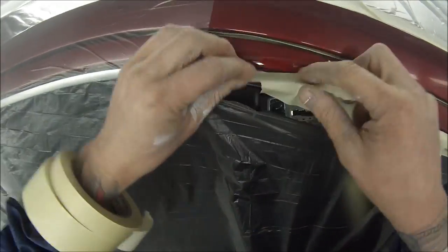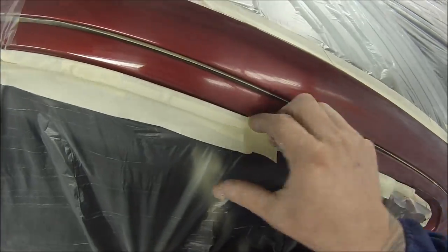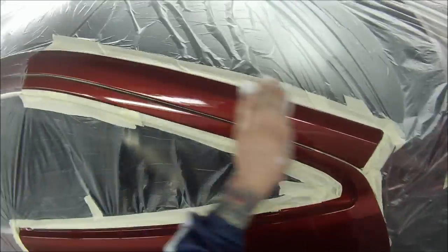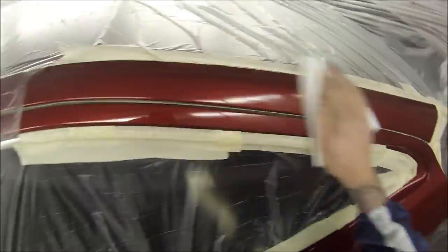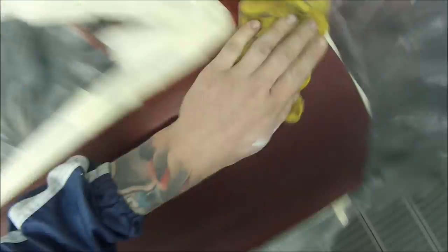This is the masking that's in the booth. We're just going around doing all the edge masking first, then we'll be able to shut the door and pull some plastic over the whole car, and then razor blade it out. You can alternatively do it the old fashioned way, which I used to do — you'd paper it up first and then put your plastic over after and tuck the plastic into the paper. But these days the plastic has a coating on it which the old plastic never used to. If you used to paint over the old plastic it would actually start flaking off halfway through painting and it would land back into your fresh paint work, so you never used to be able to do this. Once that's all masked up, we'll get the PrepSol rags or the static anti-static rags and wipe some silicone remover over the whole panel, and then get another clean one and wipe off.